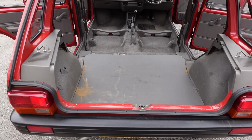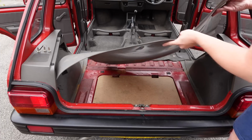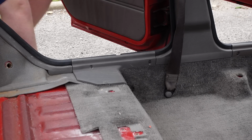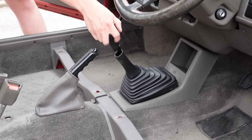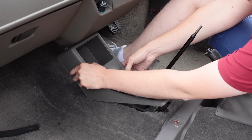With the old seats wedged precariously in the wheelie bin, we can get rid of the carpet too. Someone's used the boot mat to spray something on. Amazing, isn't it? Before we can remove the carpet itself, it's secured to the sills by these plastic trim pieces secured with self-tappers. There are 4 side doors, so 4 trims. Also having to go is the gear knob and its gaiter, then the centre console.